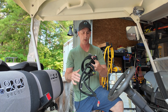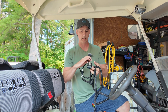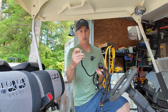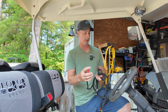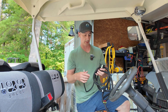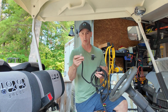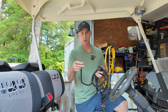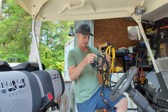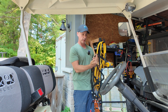With this setup we also got some wiring. This wire plugs into the battery itself, and we also have a display — you have a couple of options for that. And you have a kill switch so you can turn the battery on and off. You can hide this under your dash or put it somewhere accessible — it just turns the battery on or off. Even if the switch is off you can still charge the battery, you just can't discharge it. So nobody can jump in your cart and drive away if you have this turned off, which is a nice safety feature. This gives you enough wiring to go from your battery, under the cart, and up to your dash.